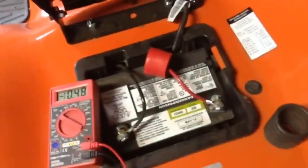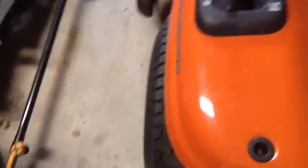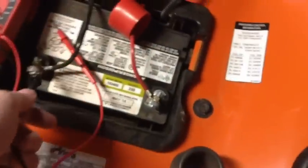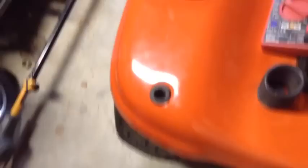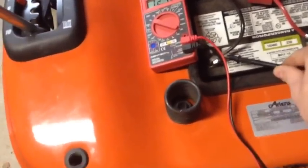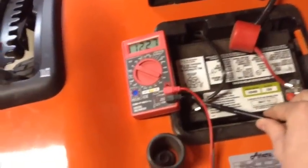First, this is probably one of the most obvious things — you'll want to check your battery. I'm going to do this with the multimeter, although you can also use your homemade voltage tester. This is for testing voltage, not continuity. Set your multimeter to DC 20 volts, set negative on negative — this is hard to do with one hand — and you should get 12 volts.